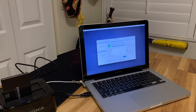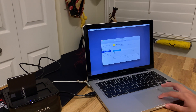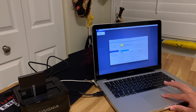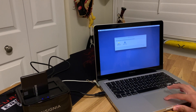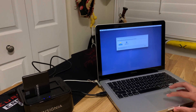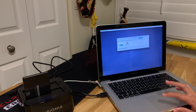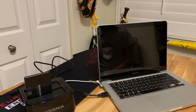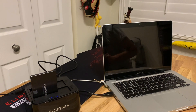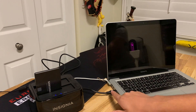All right, guys — as you can see we have finished. There's a check mark right there. The drives are mounted, so hit Done. You've basically cloned your hard drive to an SSD. Now here's how we test it: go to the Apple menu, then Startup Disk, and choose the external drive with the external logo — do not pick the internal hard drive. Hit Restart. Once you restart, the computer will boot from the external SSD on the dock. It might take a little longer to boot because instead of going through the computer directly, it's going through USB 3.0.